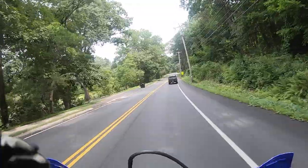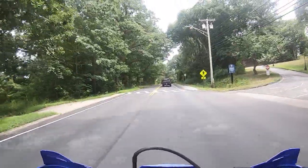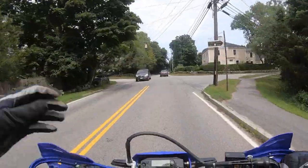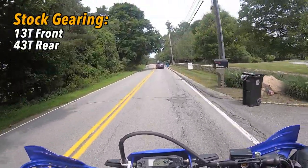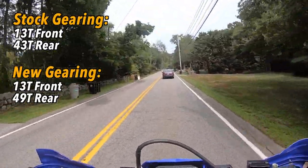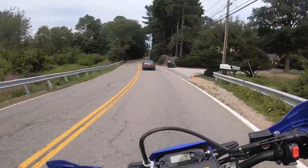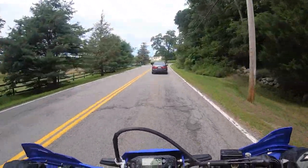Welcome back to another video. We're back on the WR250R and today we have some electrical work to do — well, the impact is actually not so minor. As many of you know, I upgraded my rear sprocket on the bike to a 49 tooth. The stock on this bike is a 13 tooth sprocket up front and a 43 tooth in the rear. I left the 13 tooth alone up front, and installed the 49 tooth rock sprocket in the rear because I've been going off-road quite a bit more. With the stock 43 tooth rear I was stalling out left and right in the woods.